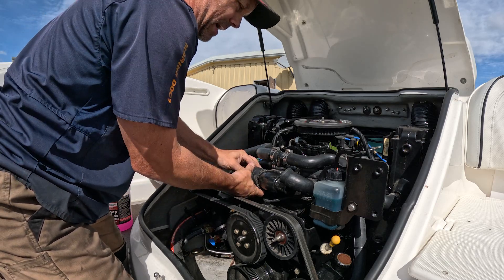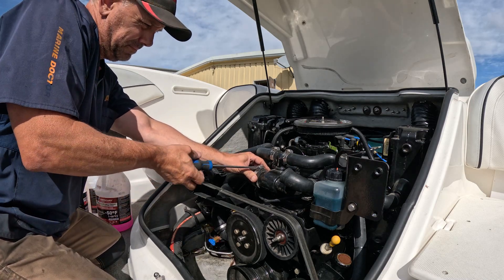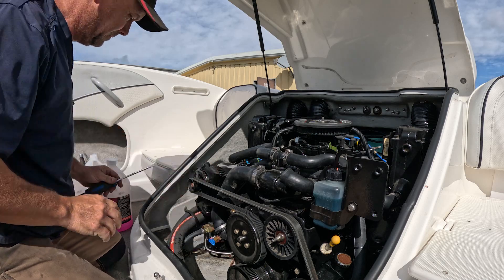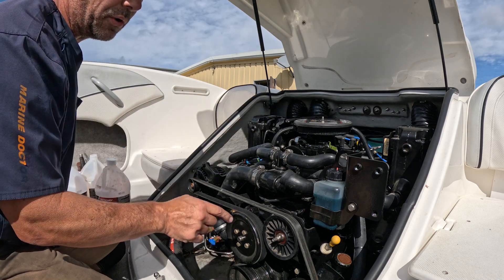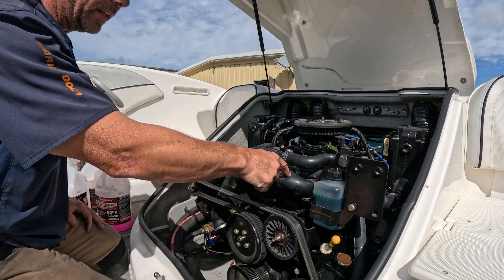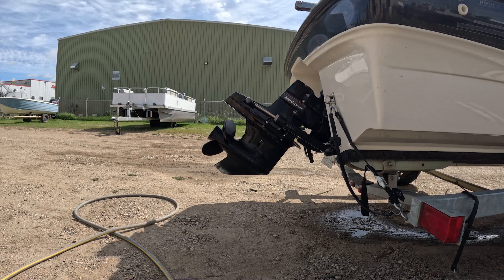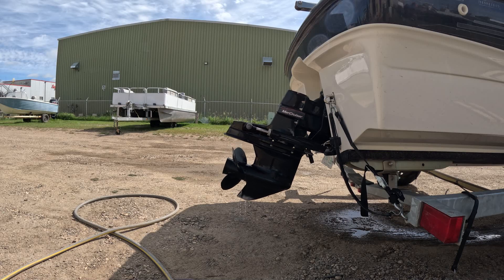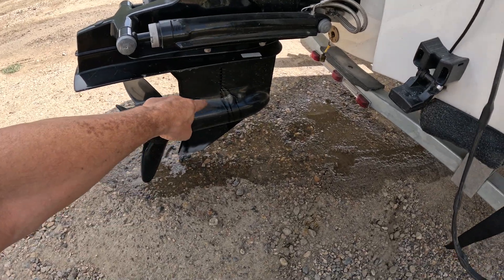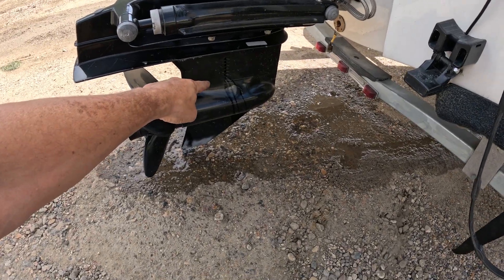We're going to put this hose back on and immediately put the clamp back on so that we don't forget it — put it at the top and spin it tight. This hose leads back down and goes through the power steering cooler. The power steering cooler has water in it which we need to flush out. This is done very simply by pouring the coolant into here, but one other thing has to take place — we have to lower the drive. With the drive lowered we can see that there's water coming out through these holes.